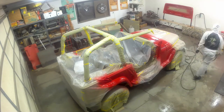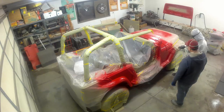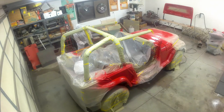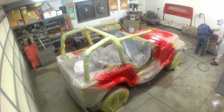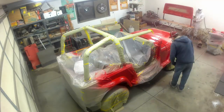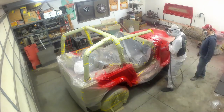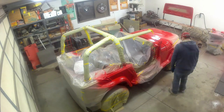It looks a little crazy when I spray the hood - remember there's a stencil on there, JP18 - and it came out great. This is the second coat going on. I was not shy about putting on the red - we actually did three coats of red. I was a little worried it was going to come out thick, but Dave said don't worry about it, just go ahead and put it on. We didn't give it very much time between coats - only about 10 minutes - so we just stood there and waited until the next time.